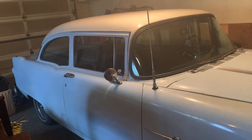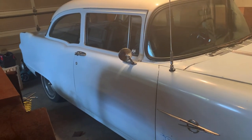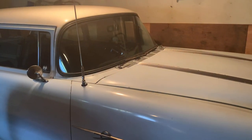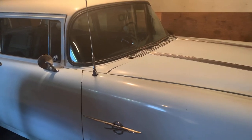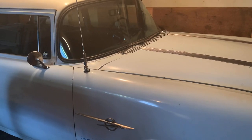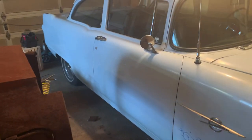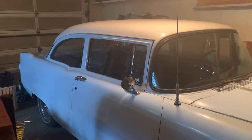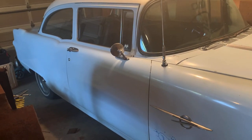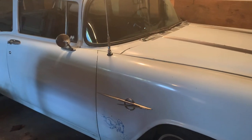Buy a kit and rewire it. This is a stock harness and it's got about 60 years worth of patches and repairs and modifications and changes and splices. There's one wire that runs up to the alternator — we took the plastic wire loom off to tidy it up and there's like three butt joints in three feet of wire. That tells you the shape of the wiring. I'm not pointing fingers at anyone — it's just 60 years of wiring repairs and there are just too many failure points.